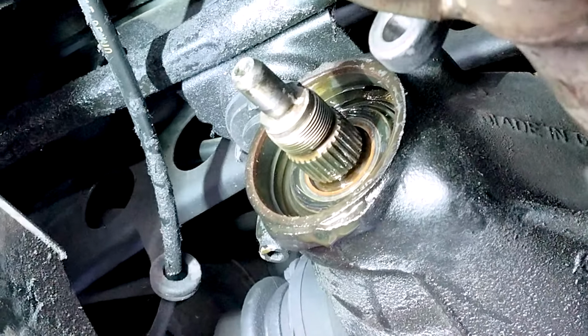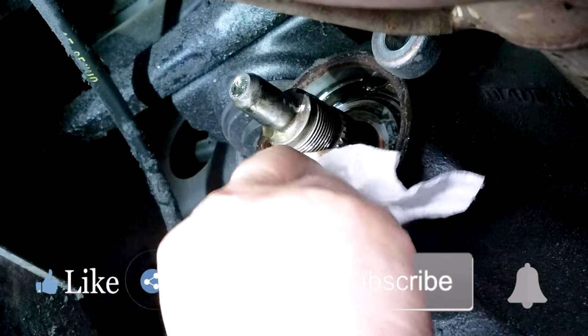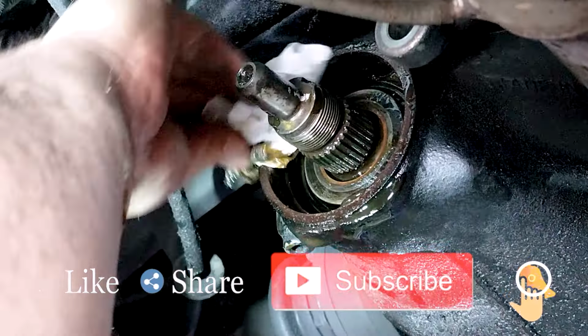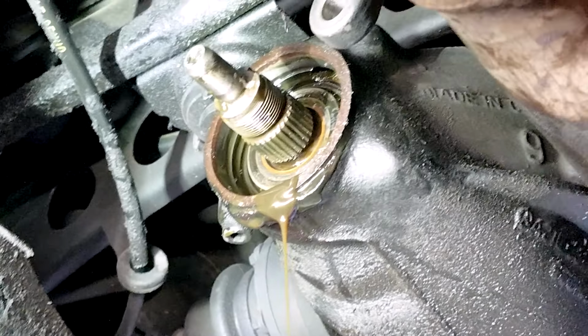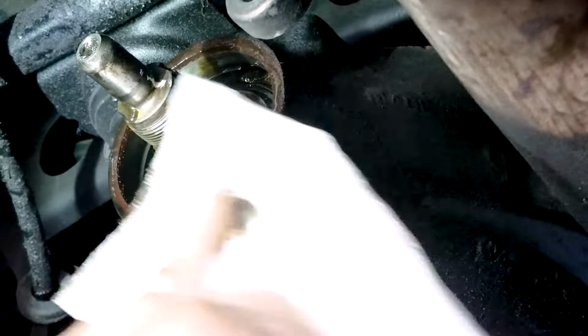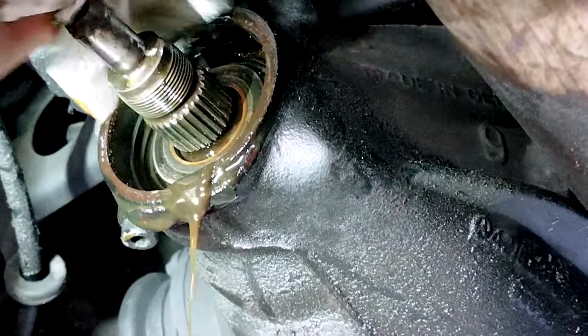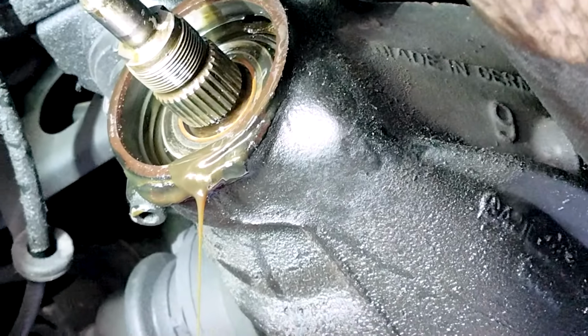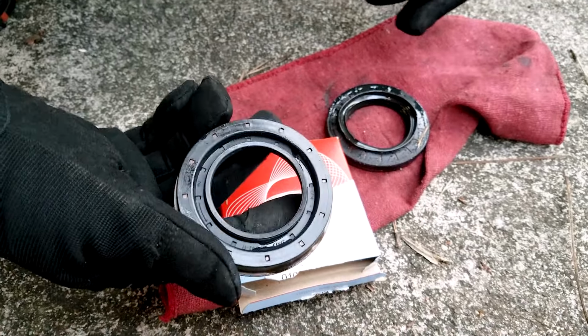This job is really not very difficult, but you must have the tools that I'm listing in the description. Otherwise, it could take you much longer to do this. When you're taking the flex disc out, you'll need to put the car in neutral. The rear propeller shaft, you'll have to turn a couple of times in order to get to the bolts and nuts. So you'll put the car temporarily in neutral and then put it back in park. And the same way, when you want to turn the flange and connect it to the differential, the tires have to be off the ground.